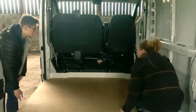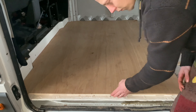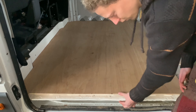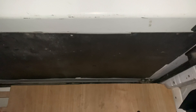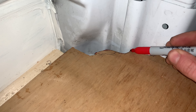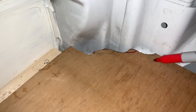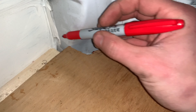Unfortunately I found a little problem. When I was cutting the length down of the ply, I went to the edge of the van floor sheet metal but didn't take into consideration the door when shut, which left me with a massive gap. It was a bit frustrating but I learned from the mistake and know not to do it again. I continued with the same bit of ply to work on the shape of the moldings. Since it didn't quite fit, I marked out little bits to snip away at, bringing it in and out of the van a few times to get it just right.